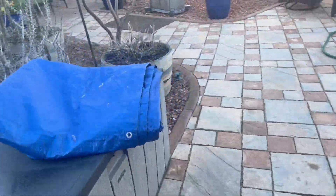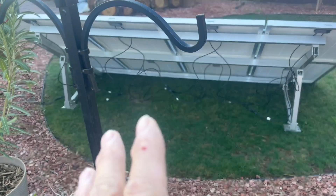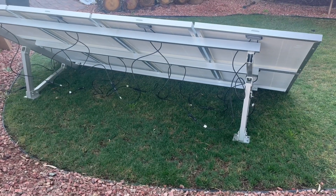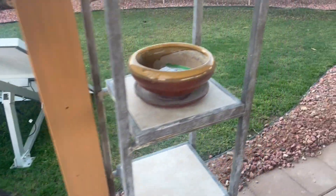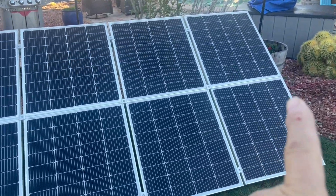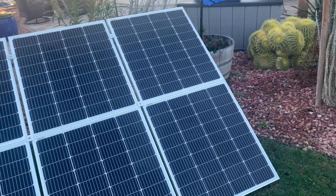The array can be taken apart and stored in the motorhome storage area. It takes about 10 minutes to assemble the ground mount and another 15 to 20 minutes by myself to put the solar panels on. Right now I have these eight 100-watt panels wired in series, going to an EG4 charge controller inverter that I'll be mounting in the motorhome — wired one to the next all the way through.